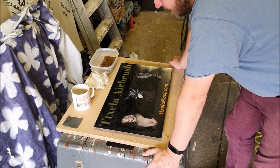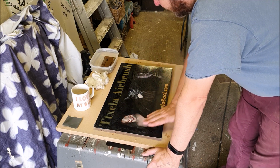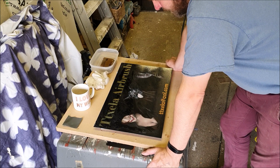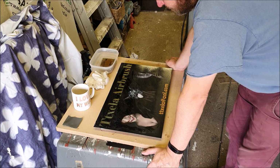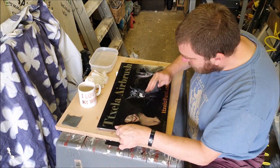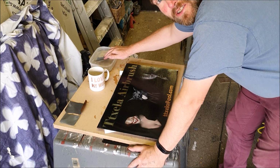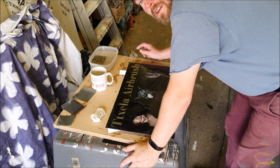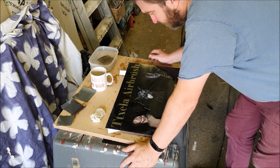I suspect we are going to end up having to do another flow coat over this, but I want to get this as flat as I can beforehand to give the flow coat a chance. I think when we do the flow coat, the trick might be to turn up the pressure more. Anyway, on to the 1500. Right, now we're going to 2000. Right, I've got one more grade to go down, and that's 2500 grit.